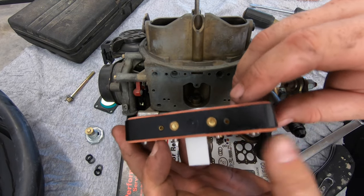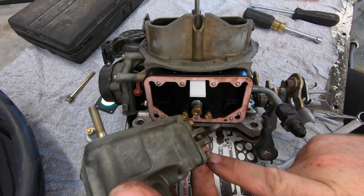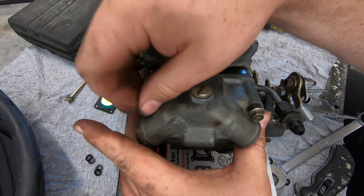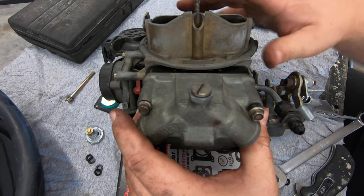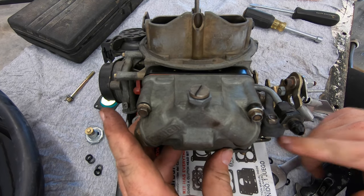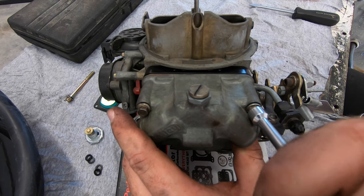Take the freshly rebuilt metering block, line the two pins up with the main body and slide it in. Take the rebuilt bowl with screws in it, put a pinky on the accelerator pump arm and lift up the accelerator pump linkage. The instructions have a neat trick where when you're tightening down the bowl bolts, you rotate the entire bowl to take out any slack between the accelerator pump arm and linkage while you tighten down the bolt. If you want to add this to your rebuild routine, treat it like side bets in Vegas — either always or never, because consistency is key.